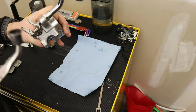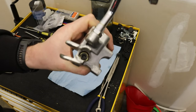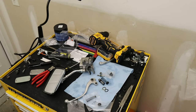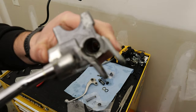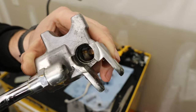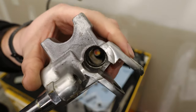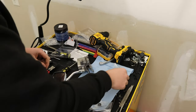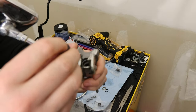Literally just rip that out with pliers or something. Now you'll see in there there's a little snap ring — we're going to pop that out as well. I did manage to get the snap ring removed. Essentially this is the bore of your clutch master cylinder. I'm going to clean this before I put it back together. The bore is actually looking pretty clean — there's no tarnishing, no rust. That's what you want to look for: no pitting or anything like that in one of these is very bad.